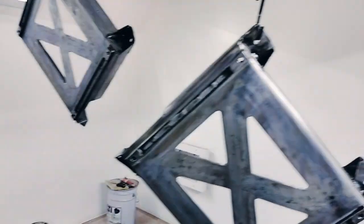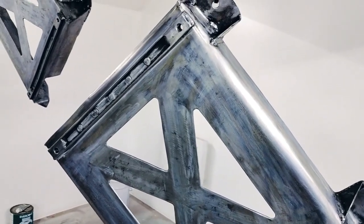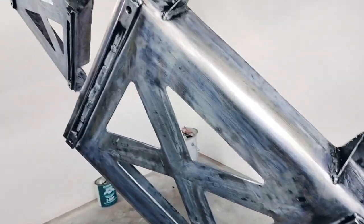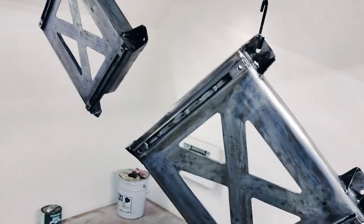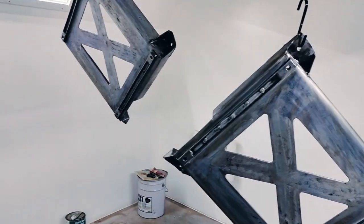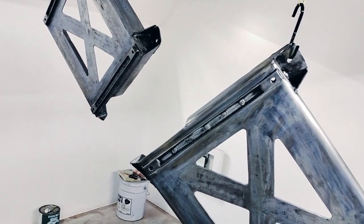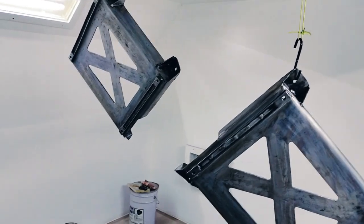And you should get almost, I describe it as a rainbow effect. There's all sorts of different colours going through it, but it does change the metal. Great prep for the metal as well. Well, I like it anyway, because it gets rid of any flash rust that might be on the steel. It certainly removes it. You can see it coming off. So yeah, great process for painting, but be aware you don't get long after you prep it.